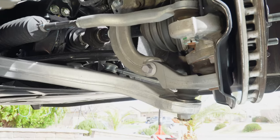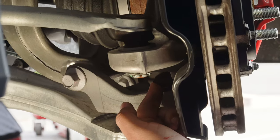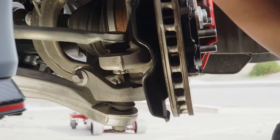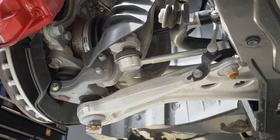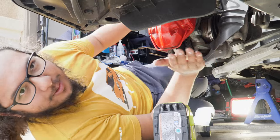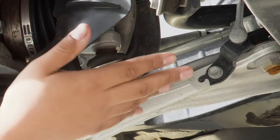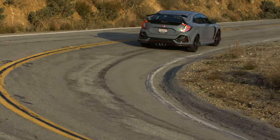There are actually three ball joints: two do the job of steering the car and one just braces. We have the upper ball joint, then the lower ball joint of the separate hub carrier, and then the lower ball joint of the control arm. The suspension geometry runs through the two outer ball joints, and the bottom one only acts as a pivot. There's also an integral link out front that braces the non-turning part of the knuckle against the control arm — it's a wheel-hop reduction link. When the axle is twisting under hard acceleration, this helps prevent axle hop so the car has traction and doesn't freak out off the line. Let's take a drive to see what all this engineering feels like on the road.